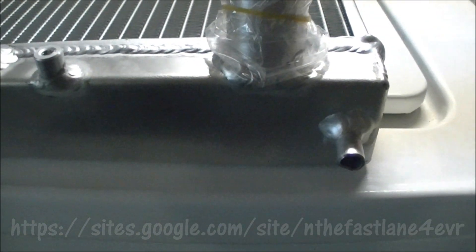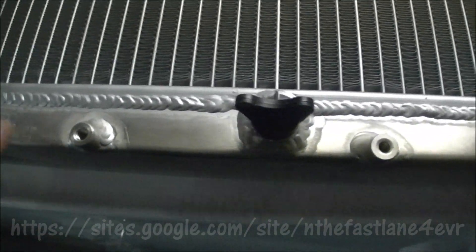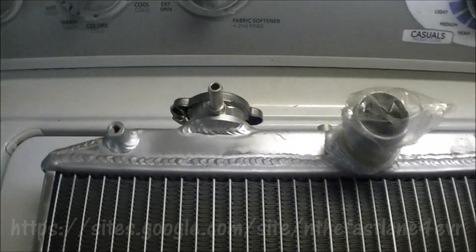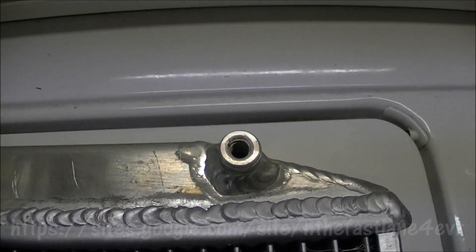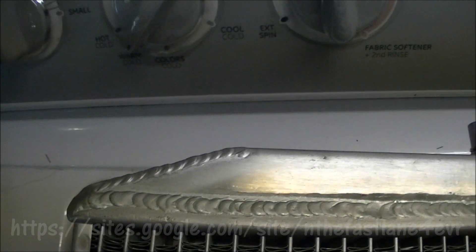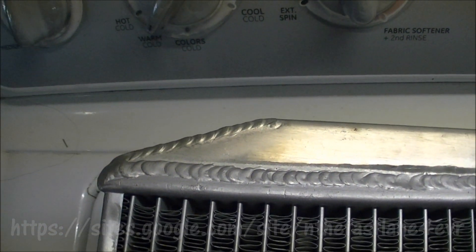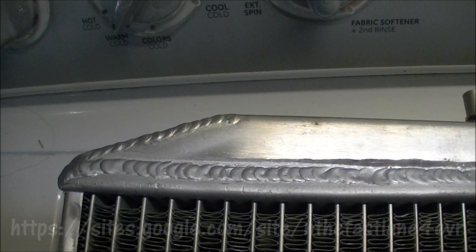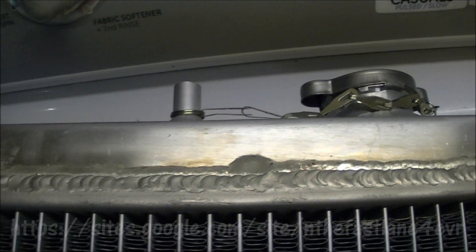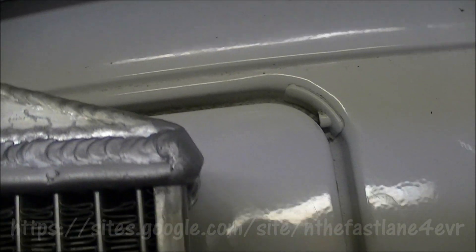You've got your two feet where you put your rubber grommets — these are for your OEM fans so you can bolt your OEM fans right up. Here at the top on this side, I'll flip it over. Here's the other side; they make it downward like that because on most Hondas when you go to slide the OEM radiator in, it ends up hitting the frame and scratching it real bad.